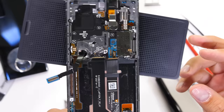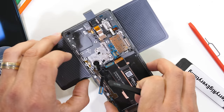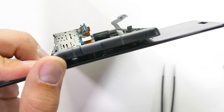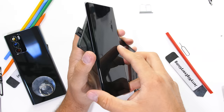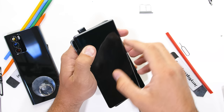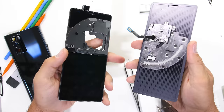In order to get the front screen off, I imagine it has something to do with these six large Phillips head screws. After those are gone, the screen wants to come away from the phone, but it's still connected somehow. After a lot of unfruitful jiggling and wiggling, I realized the screen itself had a little hole in its sliding mechanism, kind of like how we'd find in a hotel room chain door lock. Once I got those internal screws removed, it gets loose enough so that the hole can be lined up and popped off the body of the phone.